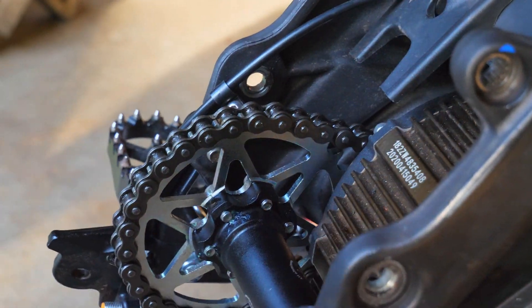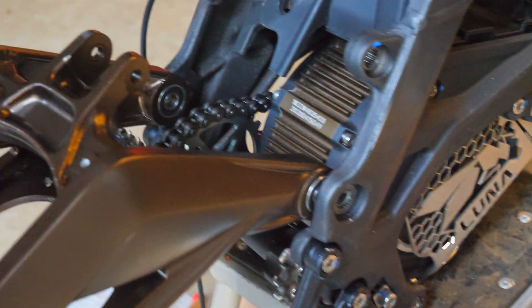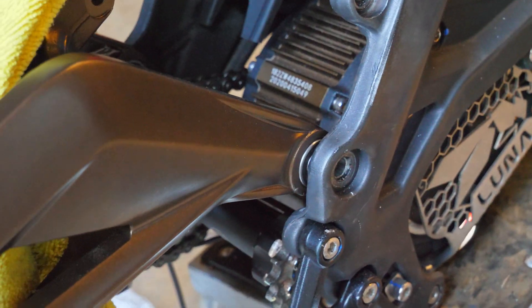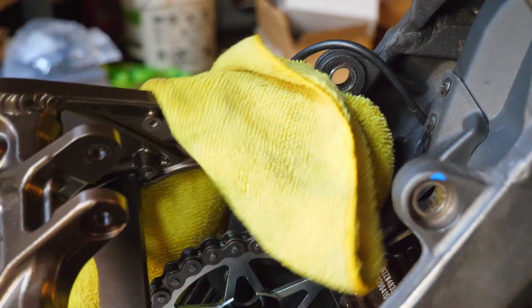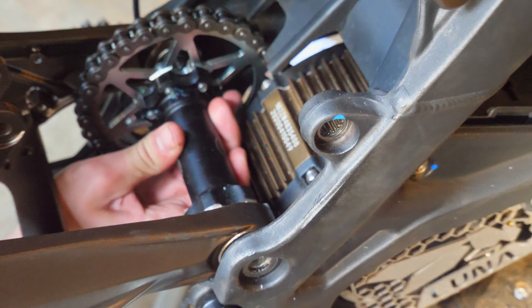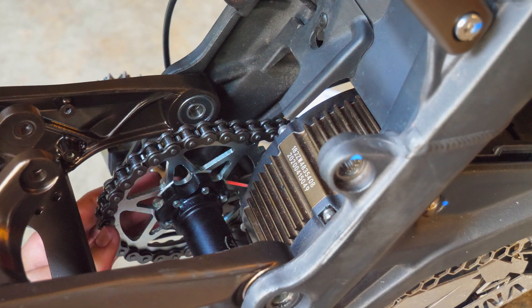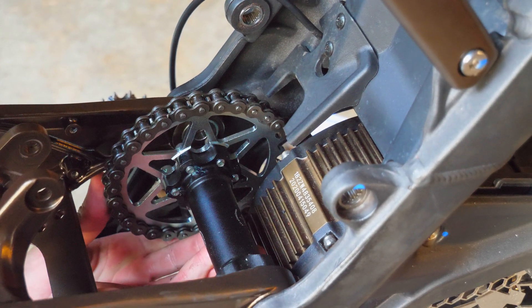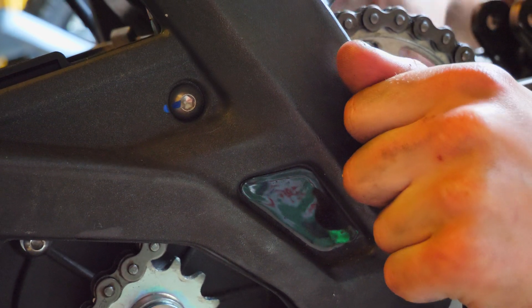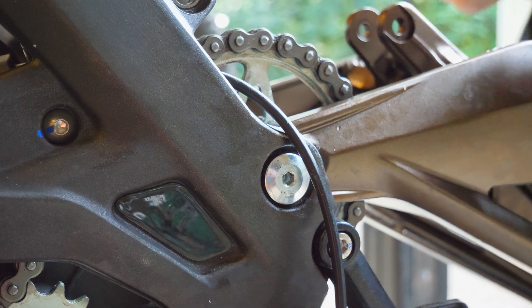Once you have the hub back together, wrap the chain around it, set it in there, and you'll be ready to put the swing arm on. The next step is to get the swing arm back on — it's kind of difficult so you're going to have to tap it in with a hammer. There's just no good way to do this, you're going to have to struggle and fight it. Once you have the swing arm wedged in there between the bike's frame, you've got to do the same thing with the hub. This one's even worse because there are lightly set bushings in there that need to fit inside the bearings — I ended up having to grind them down to create the clearance to get them in. Once you have it all in there it's time to put the swing arm bolt back through — tap that in, throw some grease on it, and you'll be ready to put the nut back on.